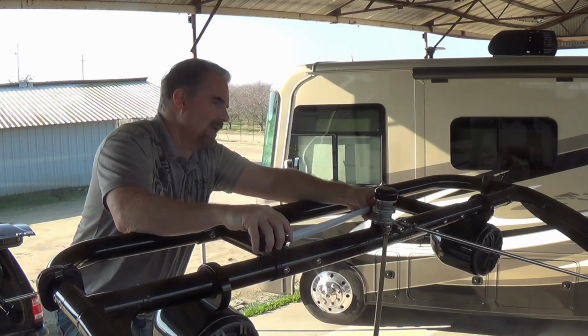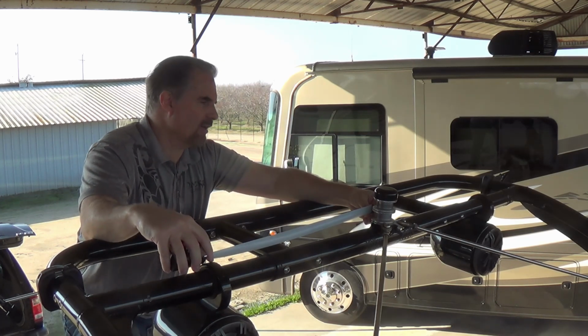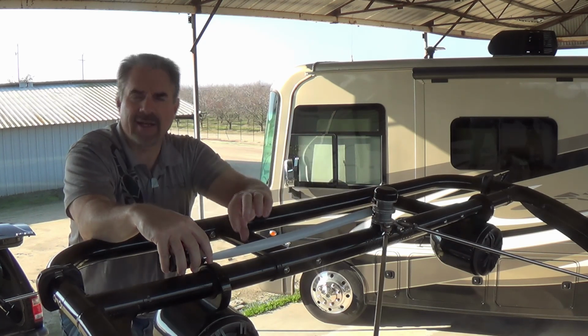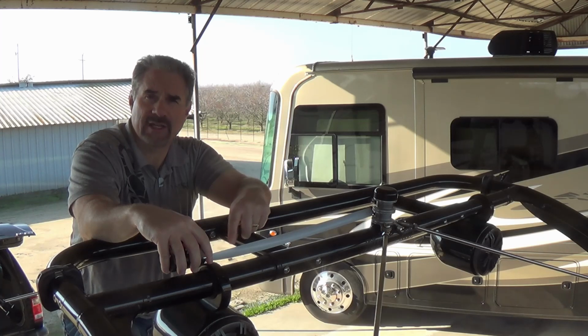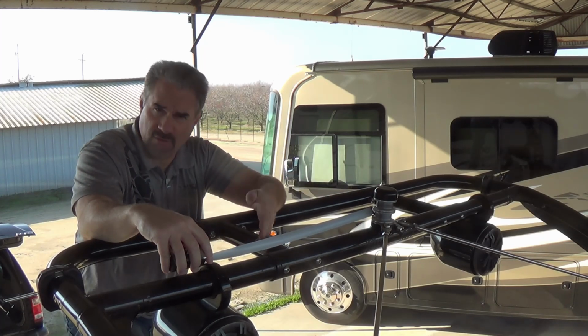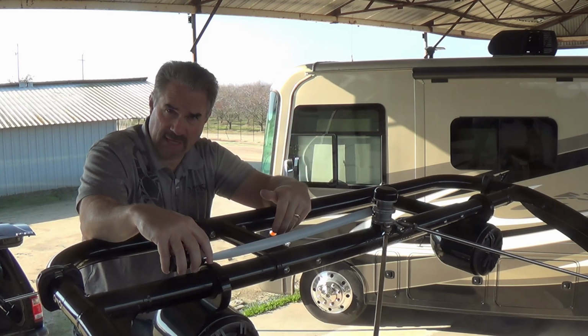So line up your tape measure about in the middle of the ski pylon and then measure out 18 inches. You're going to need about 1.5 inches at that location, so about 3/4 of an inch on either side. If you happen to have an obstacle there, then check the 15-inch location. If there's an obstacle there, then look at the 12-inch location.